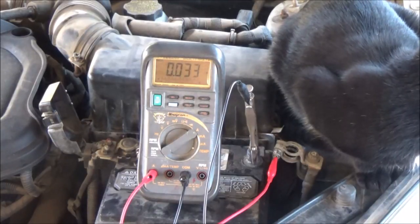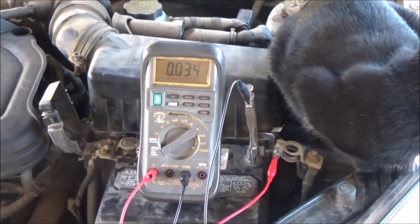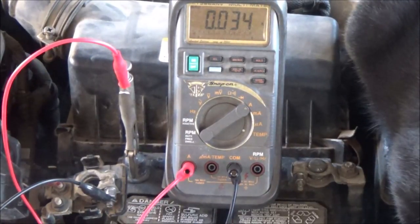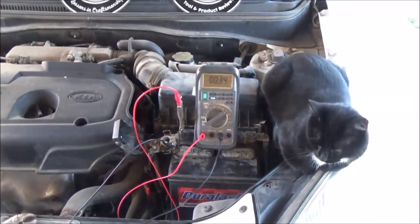I'm going to do something quickly just to prove it on video since we're stabilizing around here. People have a lot of controversy about whether you should do the negative or the positive terminal. I'm going to do the positive just to prove a point — there's no difference side to side. To prove this parasitic draw test is working, I'm going to go ahead and turn the headlights on and watch that number jump up.